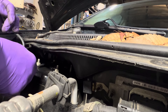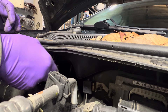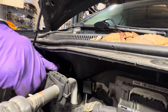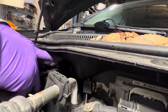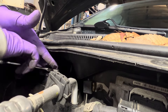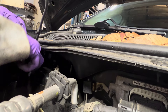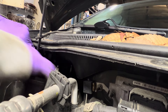I'm getting less turn now because I'm actually hitting the wrench on the cowling, making it harder. What I'm going to do is crack these front bolts loose — I don't have to necessarily take these all the way out. If I loosen them, it'll drop to as far as that bolt's already loose. I just don't want all the weight on that one bolt while trying to take it out — that's tension I don't need when it's already a pain to get to.